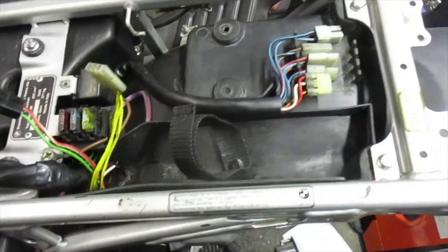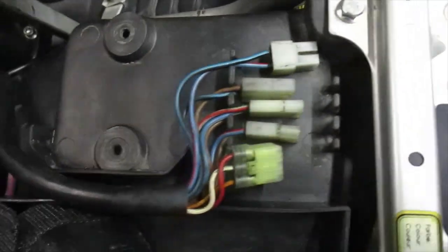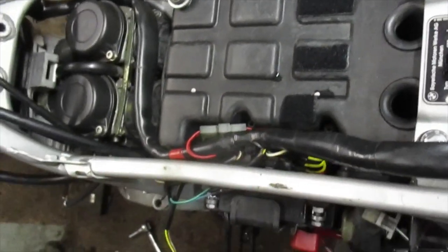Fit the battery box, cut the bolts, and then slot the battery in under the cover. Into position with the cover and the starter solenoid, then start reconnecting the wiring. Then the rear mudguard is connected up with new bolts, all cleaned up, with the wiring put in position ready to attach the CDI unit and the voltage regulator.